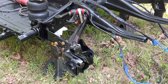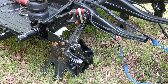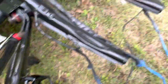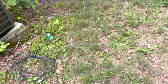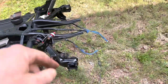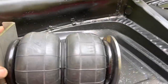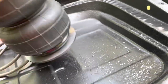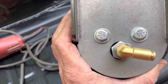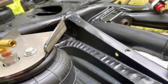Now I need to drill a three-eighths inch hole through the center on each side so I can mount the bump stops. I've drilled the holes - they're not dead center but they're close enough. Now I'm going to install the new low-profile bump stops, mount the shocks, and then start doing the work on fitting the bar for the airbags. I've already got the airbags pre-assembled with a single bolt tightened down on the bottom and bolts tightened down on the top, centering it over the fitting so that when I reinstall it it's right in the dead center. I did that on both of them.